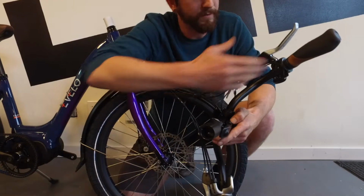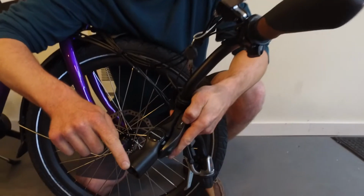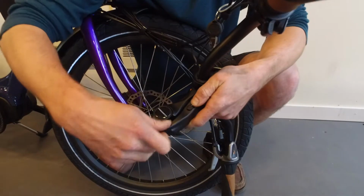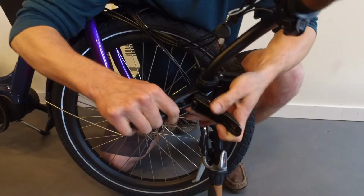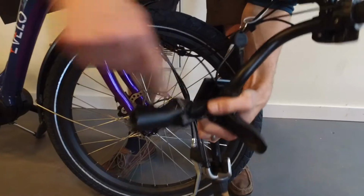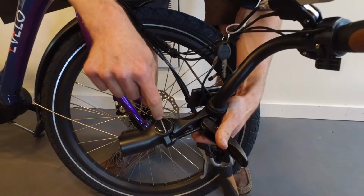After removing packaging from your handlebars, you will notice you have an adjustable stem here that needs to be aligned first. So go ahead and push this tab forward along the white arrow, flip the lever up. This will give you access to rotation and movement here. First, you're going to have to take this and pivot it inside here under the ProMax logo.